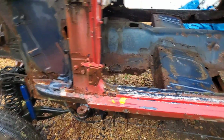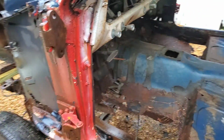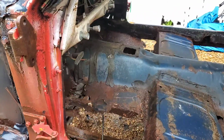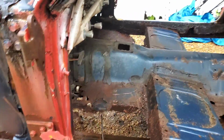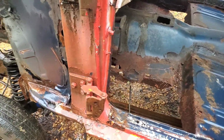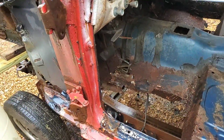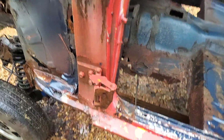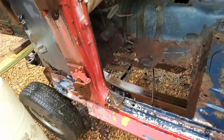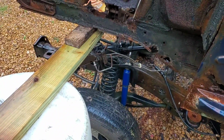So with that, I'm gonna get back to the engine, because in the process of swapping the oil pan out, I also have to put a rear sump oil pickup tube and screen on there. And I'm using a single piece oil pan gasket, not the original four piece that would have been used on that engine. Once we get all that done, I also have to show you something else with regard to the motor mount, because we might actually be lucky on the motor mount part, but that will be next. So stand by.